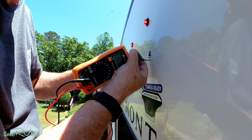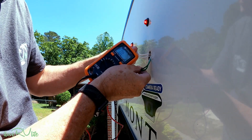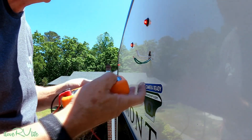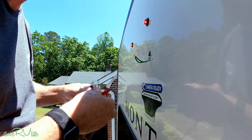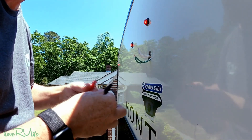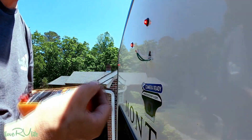And boom — 11.66 volts, 11.63 volts. There's a little voltage drop coming back here but I think that'll be within the operating range. Polarity is important — my positive probe shows that white with green stripe is positive, because reversing it gives a negative reading. So on my camper, white with green stripe is the positive side.